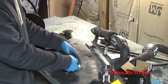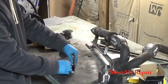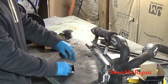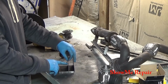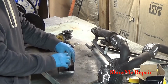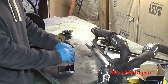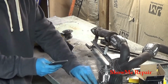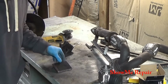So I don't know if you guys can see that. I'll weld it here, and so then that will sandwich that cross member. And then I'm going to put bolts. I think 2 should probably do enough, through the center of that, and that'll sandwich everything. I'll put them somewhere, maybe 4, and that'll sandwich that cross member, hold this piece nice and sturdy from moving, and then we can bolt the oil filter bracket to this. So I'm going to go ahead and weld these up.